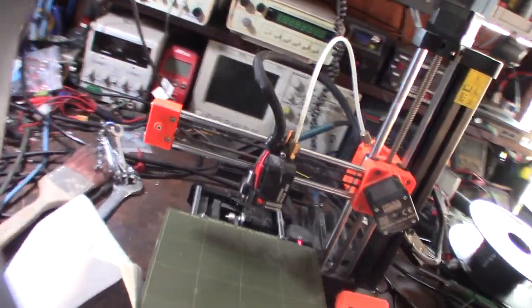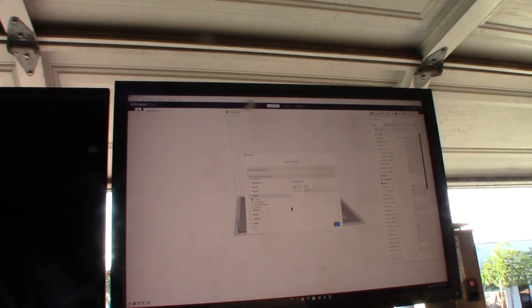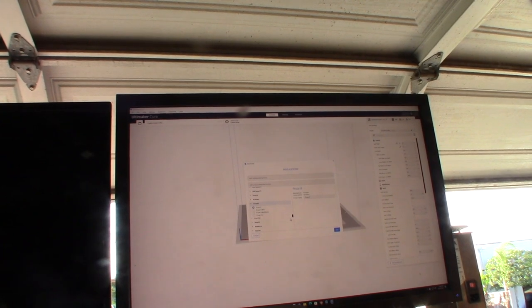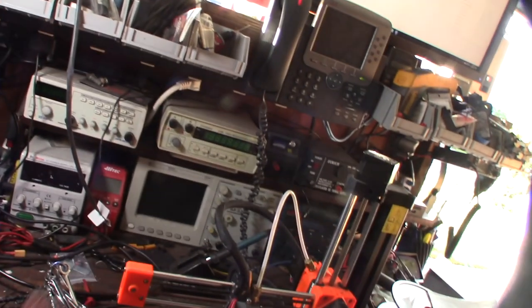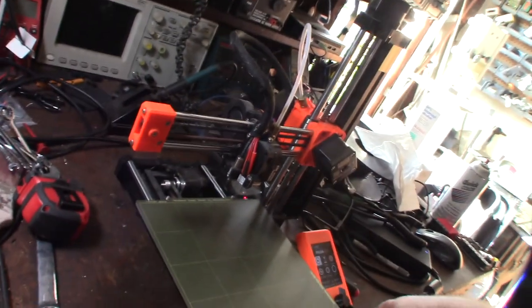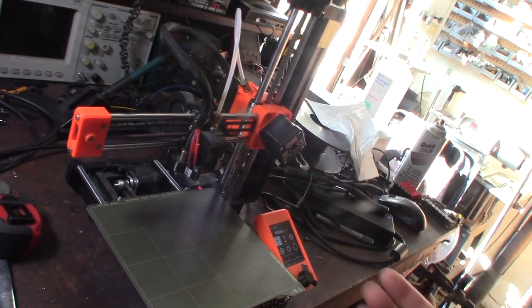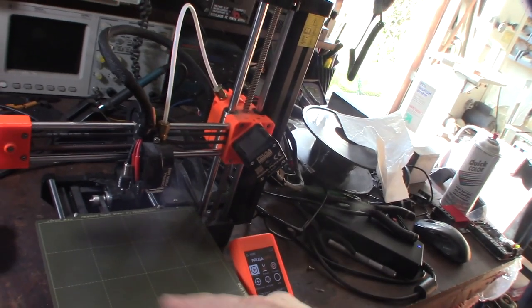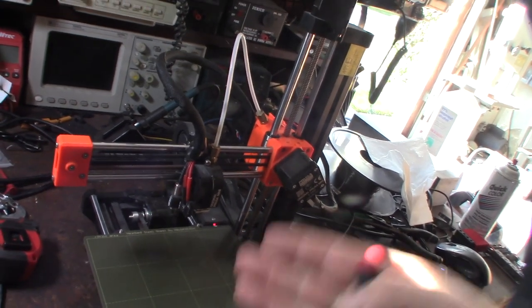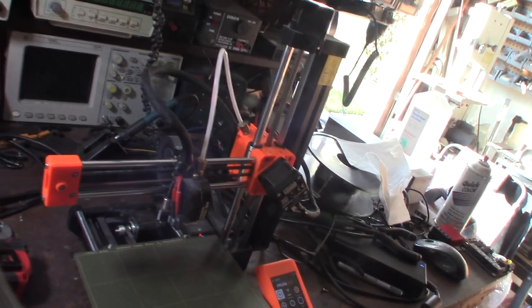They have all these wizards and stuff. I'm hoping the settings are saved. Let me check calibration. There's no default profile — I don't want to bother learning Prusa Slicer. When you don't have a printer profile, you choose one that's close enough — all these printers function the same way in Marlin. The main thing is measuring the bed size so it prints at the center. I'm going to set it to Prusa Mini. It probes the bed — there's an auto leveling sensor here. The firmware might save the offset as part of calibration. You don't have to run G29 every single time, but I'm going to run a regular G28 homing cycle then start the print, skipping G29.